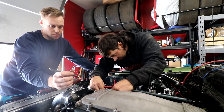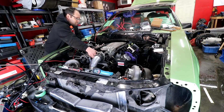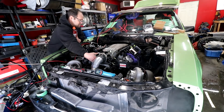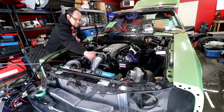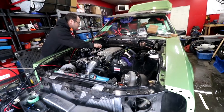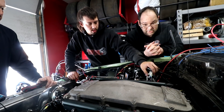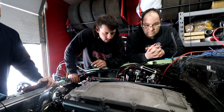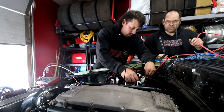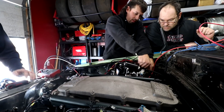Now we're going to fire. We're going to see what happens. Something gets smoked out. All of a sudden it stopped completely — I can smell it. It stopped firing, almost like all the injectors said no, or all the coils said no. Are all our connections tight? This isn't tight right there — oh, that's our ground. That's the main ground. Try and tighten this one.